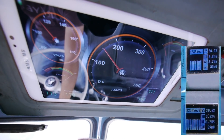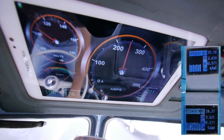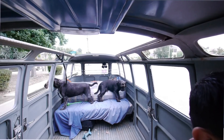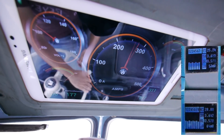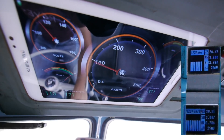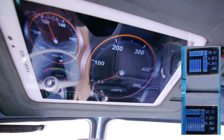The Samba's rolling around with actual Tesla batteries. You can see to your right that I'm using two cell logs to monitor one module. Every single group of cells is represented by one bar. Bruce and Wayne are my sidekicks, so they come along for this test. The voltage is about 123 volts. It goes down to 95 under load, so they are sagging quite a bit — but keep in mind there are only 44 cells pushing this car right now.